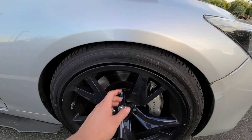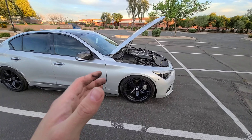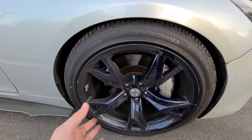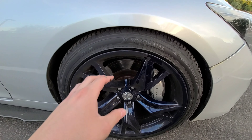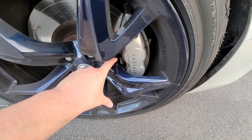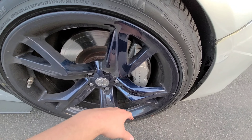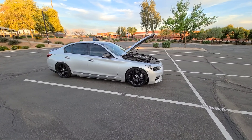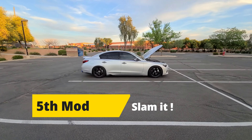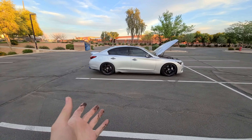The wheels are actually magnesium blue — I had them painted. A common question in the forums is what wheels will clear a big brake kit. It has a lot to do with wheel design and offset. For example, this wheel curves in a way that clears the caliper where a flat design would have hit it. I'd highly suggest test-fitting your wheels before purchasing to make sure they'll clear. The next mod I'd suggest is lowering the car — it makes a huge difference in stance.